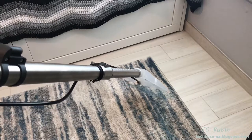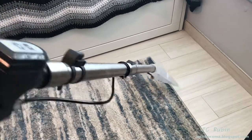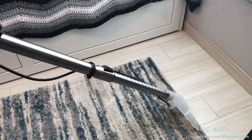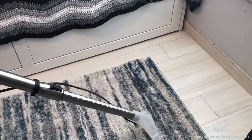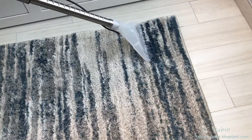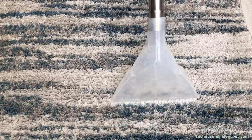Now it seems to be working fine — just purging a little bit of air in the beginning, but we have flow through the sprayer. I'm working around this square meter, just trying to wet the carpet for initial testing. This first test is more a test of the machine; this particular area of the carpet was under a table. It appears to do good work pulling the liquid out of the carpet both in vacuum-only mode and when the vacuum is running in tandem with the sprayer. I tested both features. Now it's time to move on to an actual carpet stain.